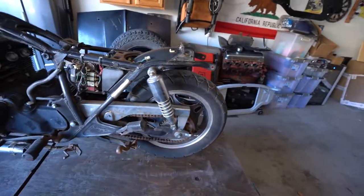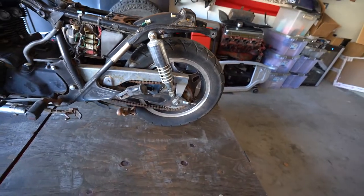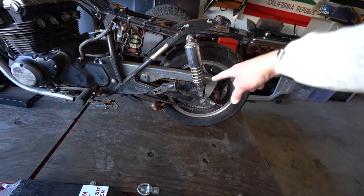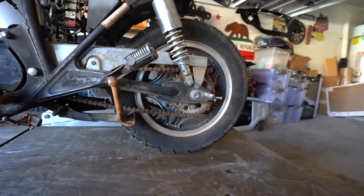The trailer did really well on the trip — I went probably 1,500 miles and didn't have any issues. I stopped every now and again to check the straps and those Rhino straps didn't budge one inch. I also want to note: be careful when you strap down the back — if you use straps on the top you're working against your shocks, so whenever you hit bumps it's going to loosen and tighten those straps. I would recommend going through the wheel well or the lower frame, then to the D-rings, so there's no suspension movement working against you. Very happy and satisfied with the trailer. I would recommend it to anyone looking for a small 4x8 utility trailer that is reasonably priced.